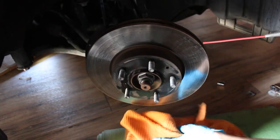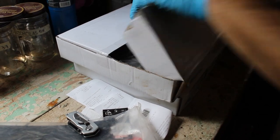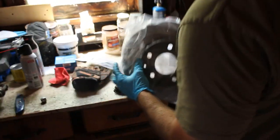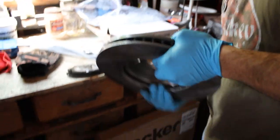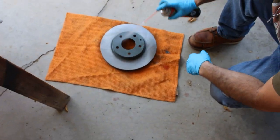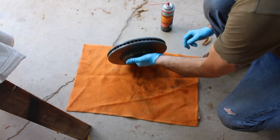When you're knocking it with the hammer, you just knock it right here. The brake pads from AutoZone have a lifetime warranty, so if you do your brakes yourself you won't have to pay for pads again. If you change your brake pads regularly you won't have to change your rotors as much. Don't forget to spray the new rotor with brake cleaner — it comes with an oily substance to prevent rust, so clean that off and try not to touch the surface.